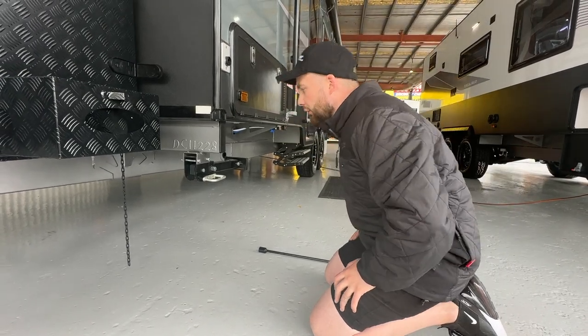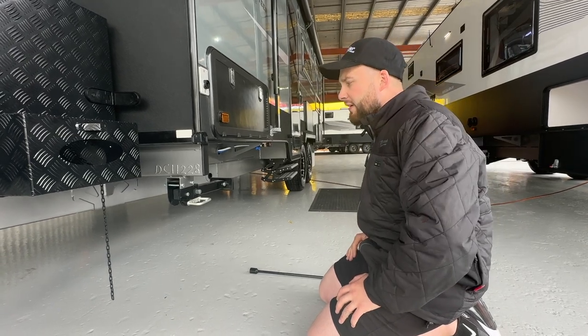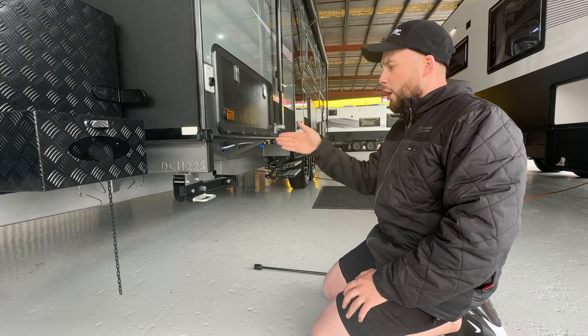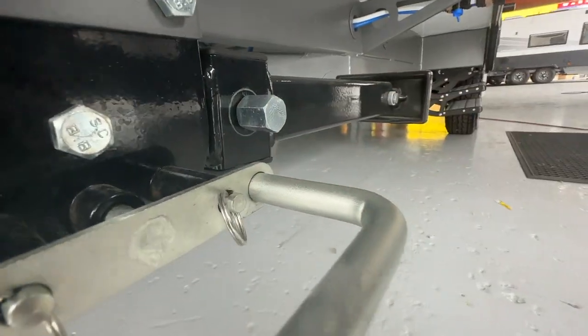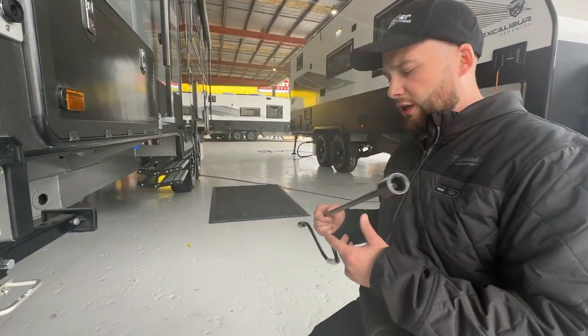Now let's talk about drills. Let's talk about the old fellas at the caravan park with the impact guns. Impact's never a good idea, because the impact gun, or rattle gun, works on a motion of in and out and around. You're going to strip the cogs in here. They're fairly expensive, fairly fiddly, really dirty, a lot of grease and stuff. Some people get this guy here, to save themselves a headache.